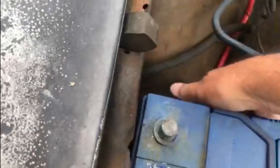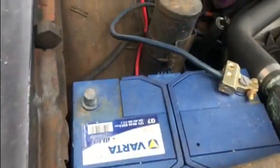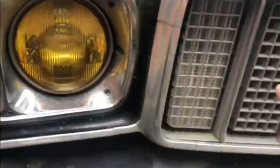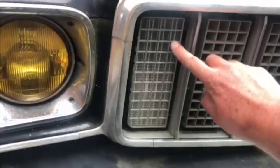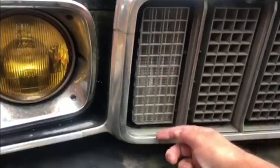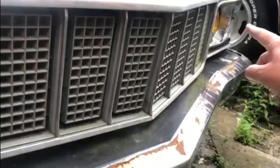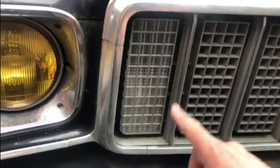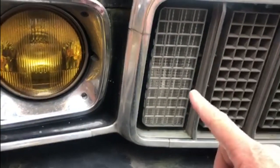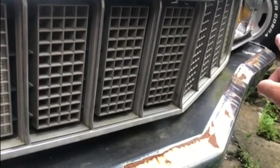Not having a side light on this isn't really a problem — let's disconnect the battery. Owing to the fact that there's a side light unit built into the headlights, I don't really need that one in the radiator grille. However, with it being such a huge panel, at night when you're driving and it's all lit up, this entire panel lights up. It looks a bit silly driving around with the one on that side fully lit up and this one in darkness until you start indicating. I've taken the bulb out of this one, swapped it into that one, and it works exactly as it should.